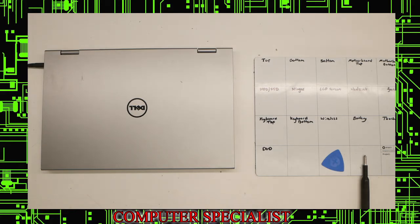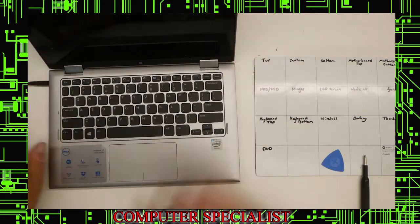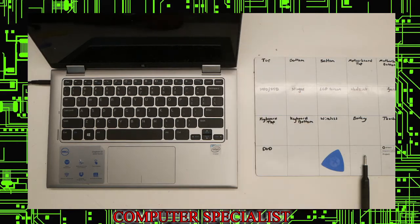Welcome to Computer Specialist Repairs. Today we have a customer's Dell Inspiron 11 3000 series — specifically the 11-3147. The unit was brought in with a traditional vicious loop circle. It has a 500 gig drive in there and it's going bad. We already did the diagnostics on it. It has a spindle drive in there and we are going to be replacing it with a 250 gig solid state.